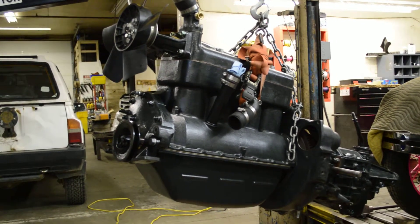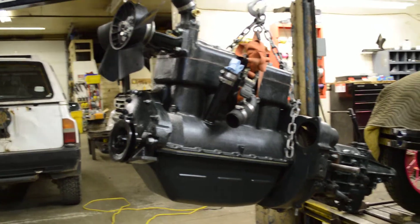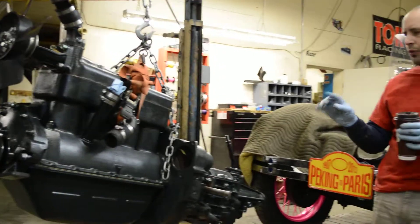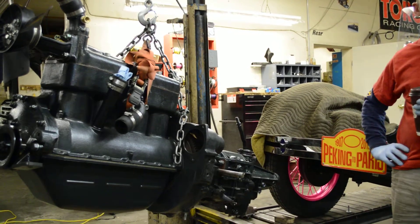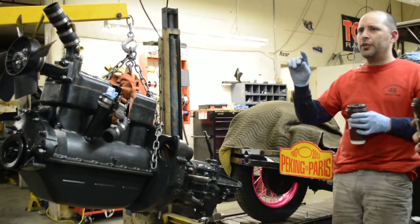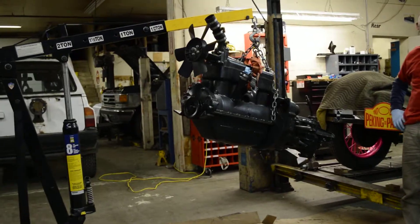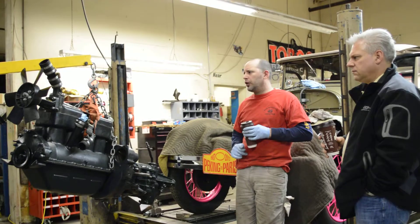Can you teach somebody how to do the choke? Well, that too — and there's evidence of it running pretty rich all along, I believe. We'll, I'll show you the really fine tuning on that adjustment. Your maximum range is from completely closed to maybe three-quarters of a turn — from like the 12 o'clock position to the 9 o'clock position. That's what we need. I'll give you the literature too so you can read over it on the carburetor.